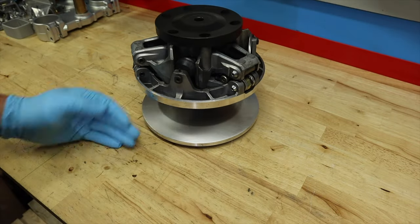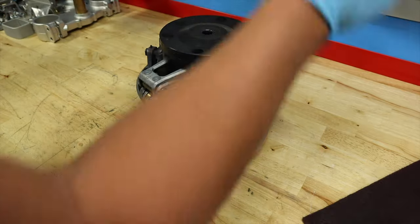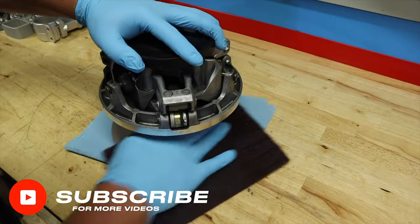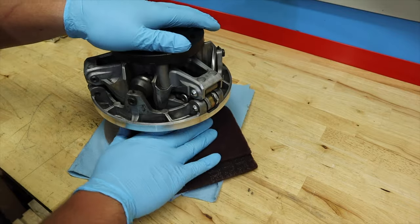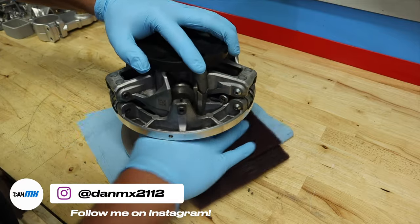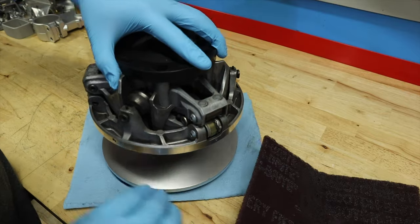The last thing that we're going to do is clean up this clutch sheave, and this is the way I've always done it — it works really, really well. I'm just going to take this and run it back and forth to give myself a smoother surface. When I spin this clutch, it's easier if you just put a paper towel underneath. Back and forth a handful of times, depending on how bad it is — obviously depends on how many miles you've got on it. The idea here is to help knock down those grooves and give it a good gripping edge again — something that's going to grip the belt. I've been doing this on my clutches for a while. It gets that sheave back to where it should be.